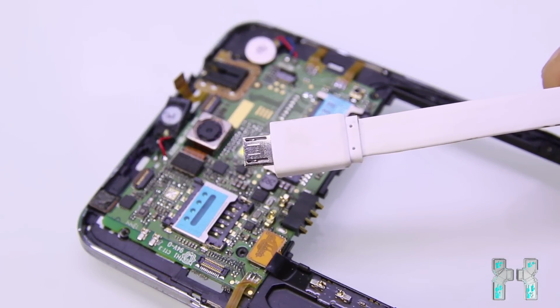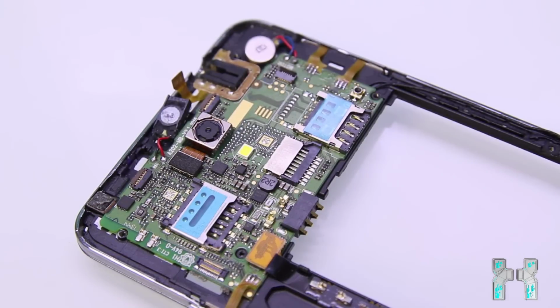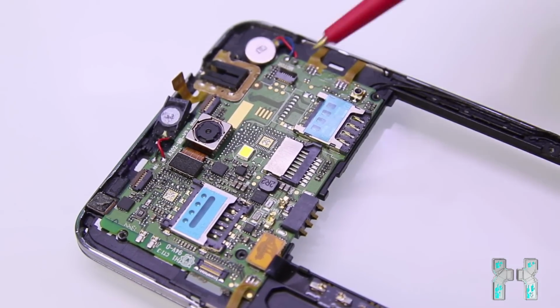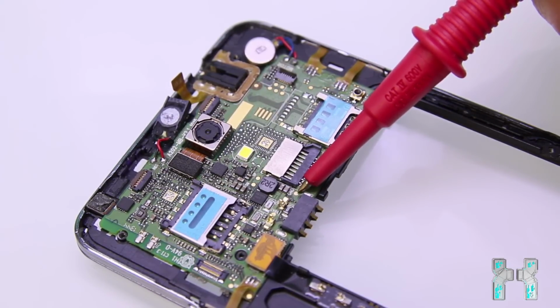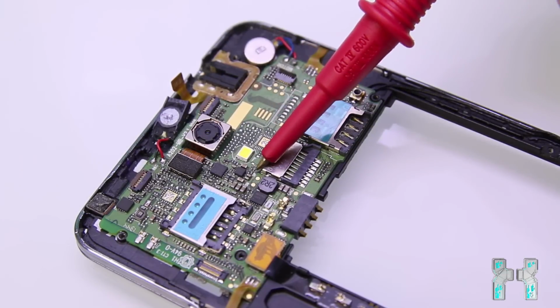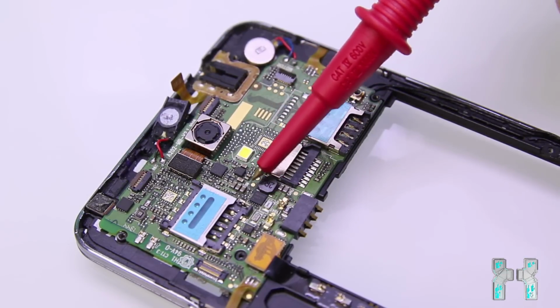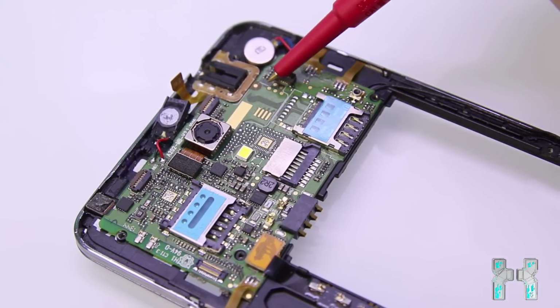You can see it right over here. And that makes sure that you know whether it was the correct contact or not when you bridge it, because you will see that the MTK USB VCOM port pops up in the device manager. And now you have to find the ground point, which you can see right over here. It's labeled with GND, that means ground. And here we'll also see VBAT or something or plus. Please don't short the contact, so don't connect them to ground.